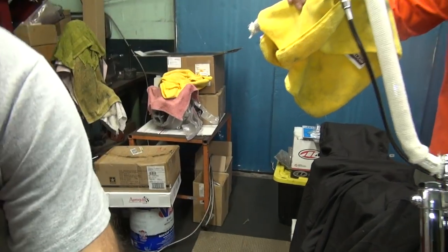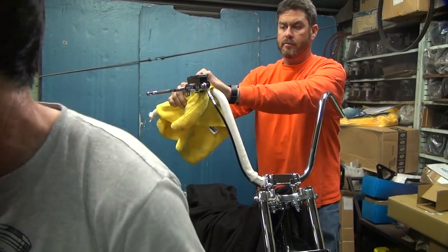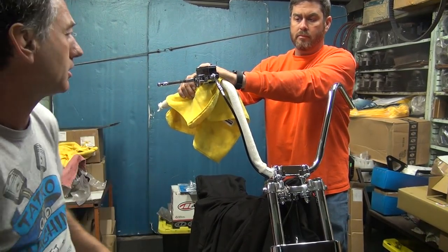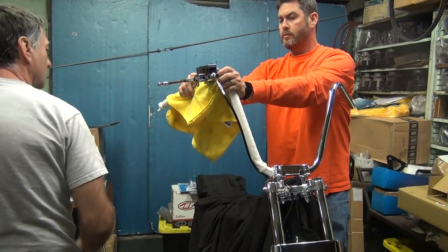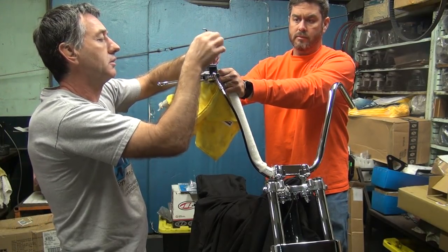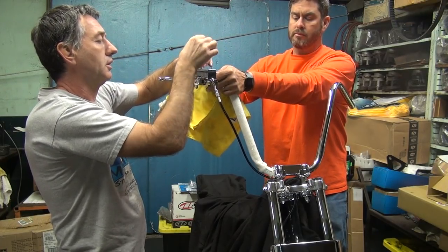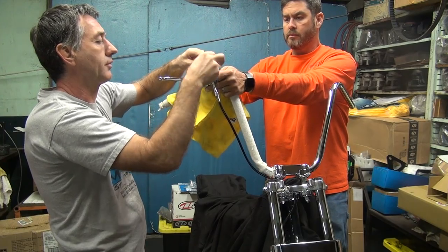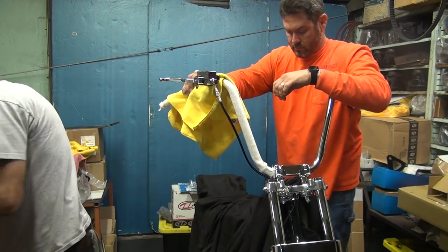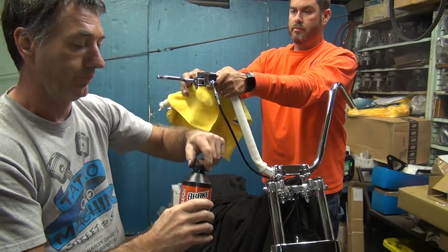Do you have the pump for it? A pump? Do you do a magnum? No, I do a gravity. I hate pumps. Pump to do it in like 5 minutes. Look at the other one. Can't have that being uphill. I do my stuff gravity feed. When the air quits coming out, it's out. We don't care if it takes 5 weeks to do it.